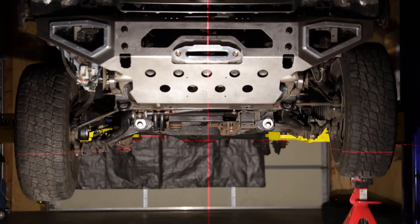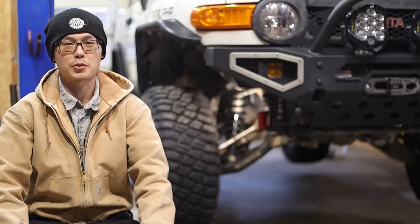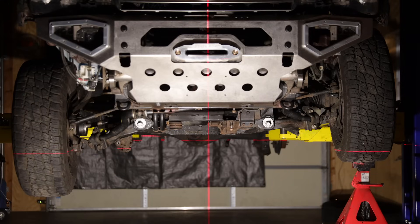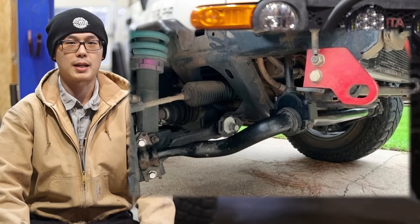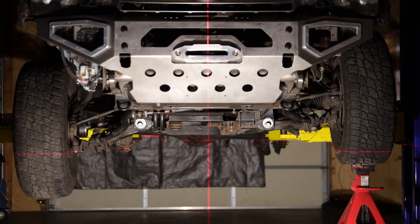However, as I jack up the driver side to simulate articulation, the sway bar pivots about the fixed link and pushes the passenger side down, achieving the 1-inch extended droop. This interaction almost feels like how a solid axle articulates — one side goes up, pivoting the other side down. If I keep going up, the sway bar starts to twist and bring the passenger side back up again, but at that point the driver side is already in bump stop territory, so you rarely get there during crawling. After installing extended travel coilovers set at around 2-inch lift, I verified articulation each way were pretty much identical and both reached full droop. There are spacers available that drop the passenger side fixed link to allow extended down travel when both wheels droop, but I do not have first-hand experience with these spacers.